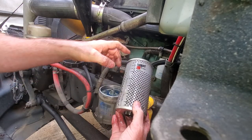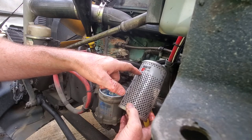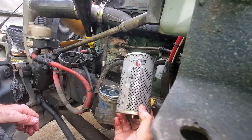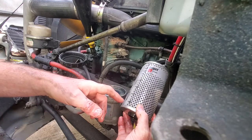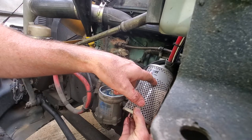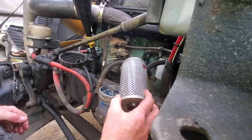Mine was filled up close to level four on the indicator — there are a lot of perforated holes but near the top you still have some holes a little bit higher. Anytime I'm doing an oil change and the filter is above level five, I just go ahead and replace it. I'm saving myself time down the road when the motor starts starving for fuel. Today it was just above the very bottom of number four.